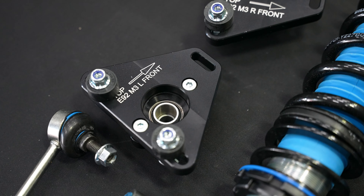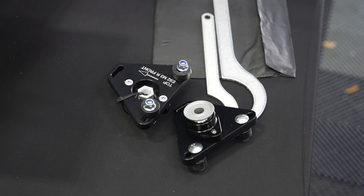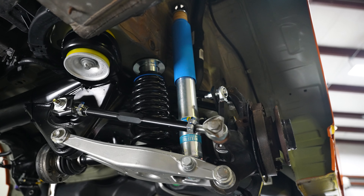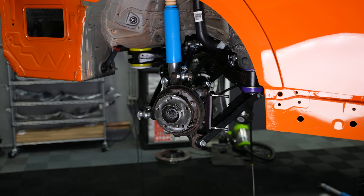It's also a shorter damper, so it'll lower the car compared to factory. It runs a 60mm ID racing spring which can be swapped out, and there are many different rates available for racing springs — another cool benefit when you switch to a coilover like this. It also has a camber-adjustable top mount with a racing bearing on top, different from the rubber mount that's normally used. So it's more about adjustability and dual track-and-street purpose.